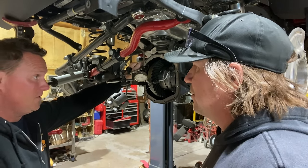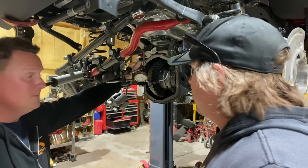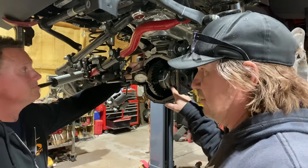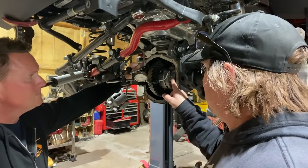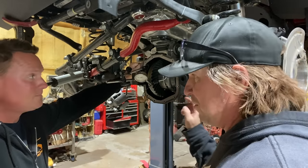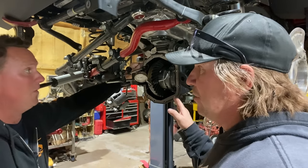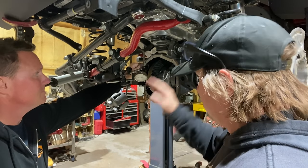That way, if you do make adjustments, you can just refer to your original thicknesses and go from there. What was kind of cool on this Dana 44 Advantech 210 was that the carrier bearings were different sizes, and the races were different sizes, and the shims were different sizes. So you really couldn't screw it up. If you have all those parts, you know that the smaller one goes on one side and the larger one goes on the other side.